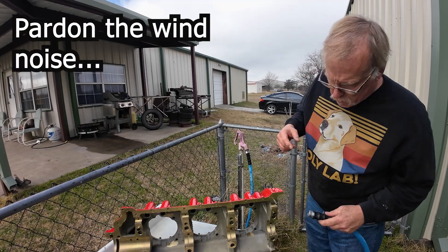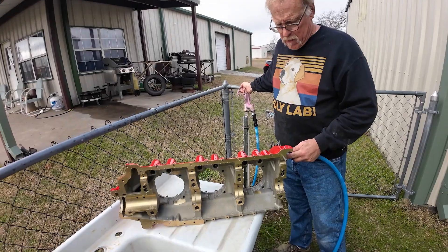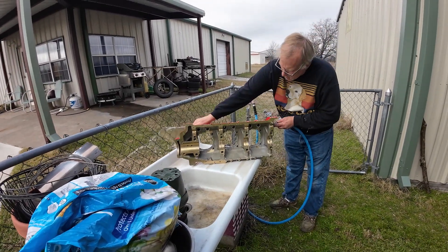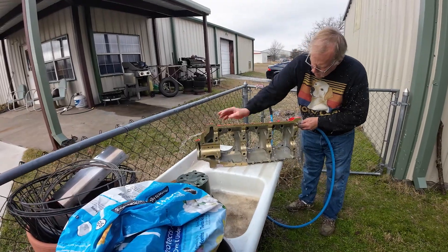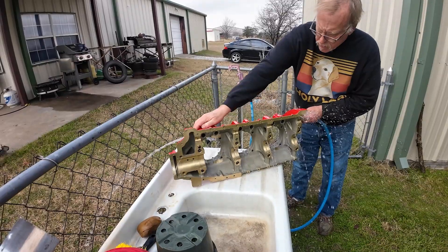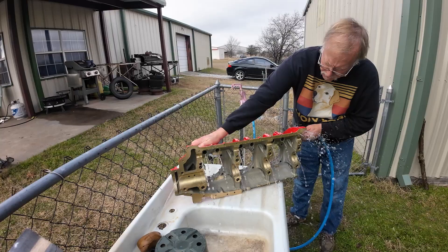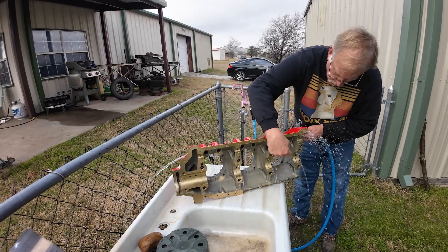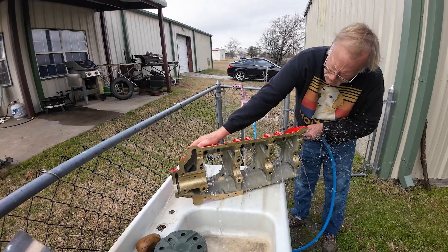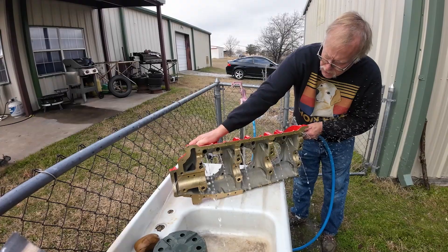Here's what it looks like where your oil is coming from. This is your oil circuit. So now you're seeing all of these up here are your lifter galleries. Those are being fed by the upper cam gallery. On the other case, that's all that's really being fed on the upper cam gallery. Then you're also seeing the main bearings — your rear and mid and forward mains are being fed also. So this is your whole oil pressure circuit.